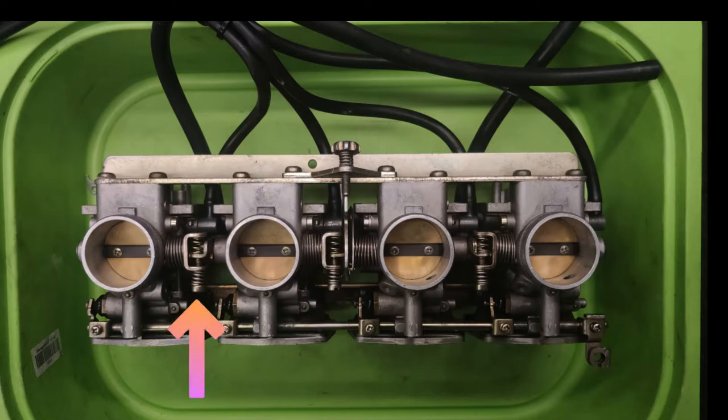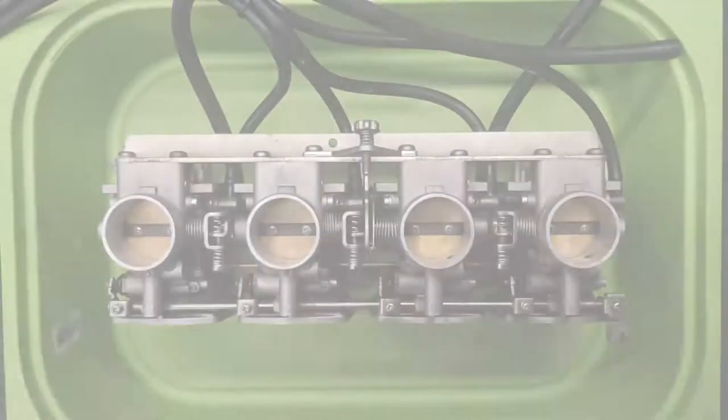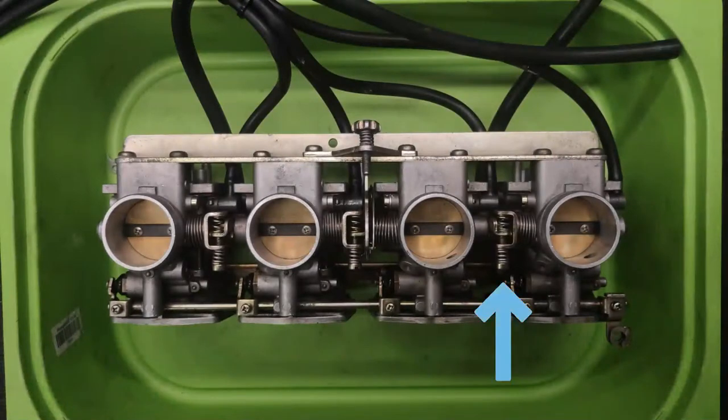But what happens when you first adjust your screw from the top on the left hand side, which brings in the two carbs on your left, and then the right hand side brings in the two carbs on the right, and the middle screw brings all the four carbs in together.